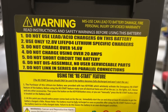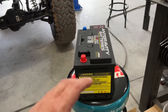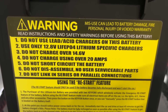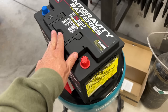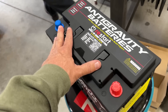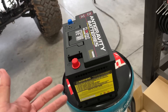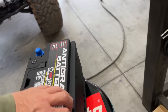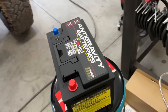Some things to note: you do not want to use a lead acid charger on this battery. Use only 12.8 volt LiFePO4 lithium-specific chargers. Do not short-circuit the battery. The biggest thing at first was the weight savings - that was awesome. And then the restart feature built in is also super awesome. People were saying they don't work in cold - they do work in cold. They work just fine. I'm going to go through the email to address that specifically. Pretty much everything I own is getting these because not having to worry about a battery for 10-11 years will be amazing.